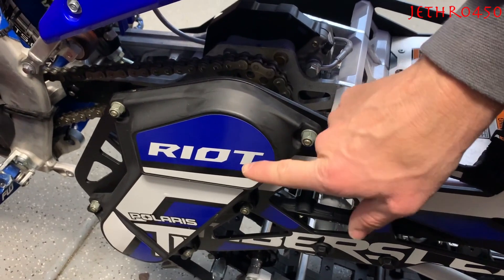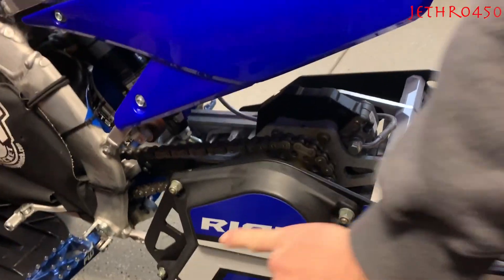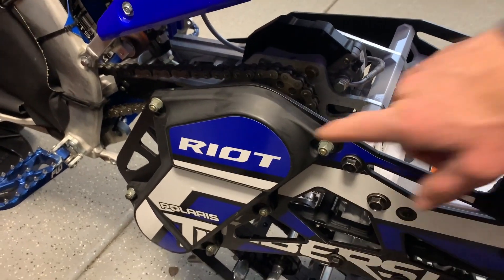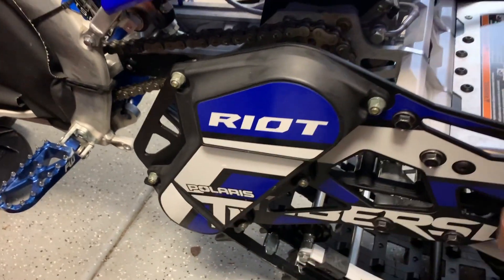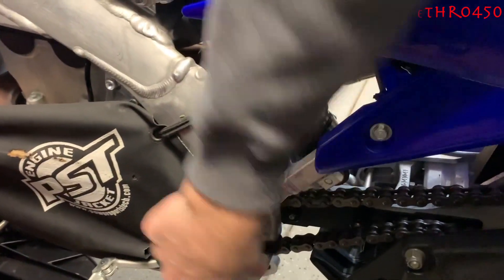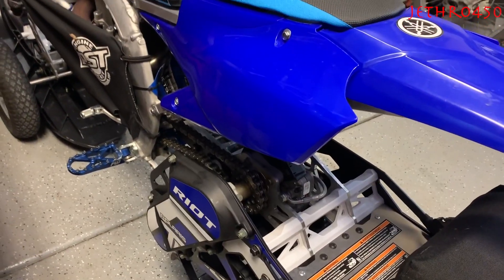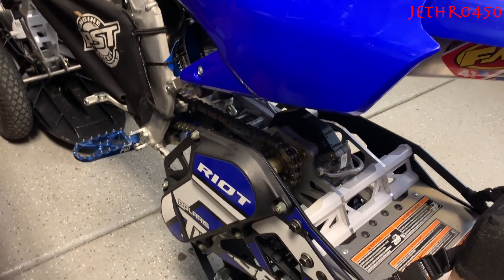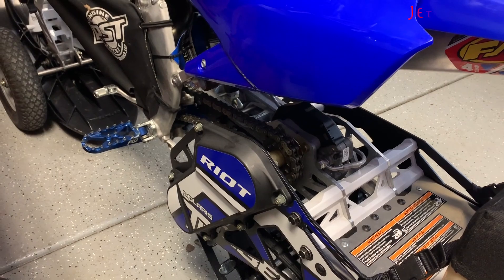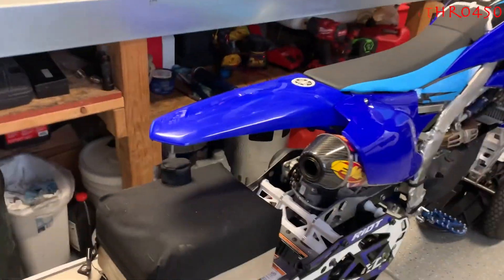I feel like these things come geared too tall. The Riot comes with an 18-tooth on top and a 17-tooth on the bottom in the chain case. I felt like I couldn't pull second gear as hard as I wanted to in the trees. The cheapest way to slow it down without overdoing it is to swap those — so 17 up top and 18 on the bottom. That's two teeth slower, but then I put a 14-tooth front sprocket on, which sped me back up by one tooth. So overall I'm only slower by one tooth on gearing. I feel like that's a perfect setup for deep tree riding — I'm in second gear 90% of the time and the bike is ripping second hard rather than lugging around.